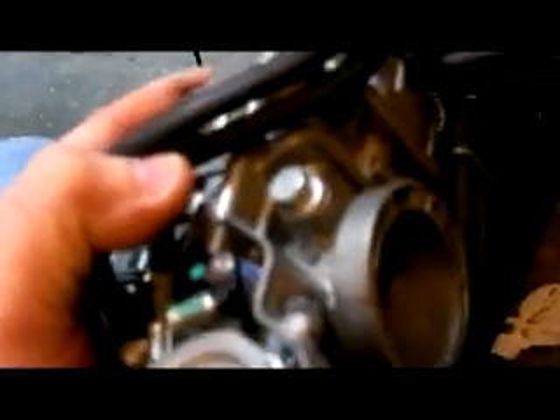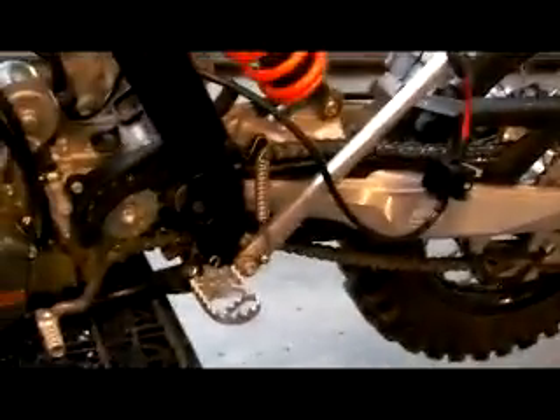I've got the Blaze Racing block-off kit and I'm about to remove this stud right here with a 12mm wrench and put in the block-off with some Loctite. Block-off nipple is in place — you can see it screws right in. It's a really nice kit because the bolt fits on there beautifully, and the hose being replaced drops down between the engine and the swing arm quite nicely. Hats off to Blaze for a really nice kit. Just so you know, the fitting that's originally on there is a 12mm wrench, but the Blaze fitting is only a 10mm.